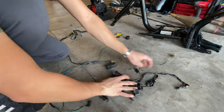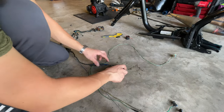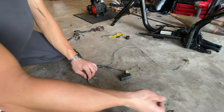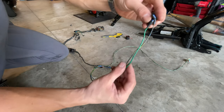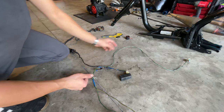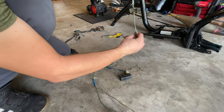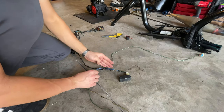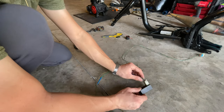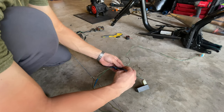So once you have removed all this trash, you have one ramification here, you got this one right here, and you got this one right here. What you want to start doing is start from the connector. So you want to start from this one, wrap all the way down here, cut the tape in here. Wrap this end, start from this connector, go all the way down, stop here, cut it off, and then this is going to be your main source. So you want to start from here, this connector, wrap everything around it.